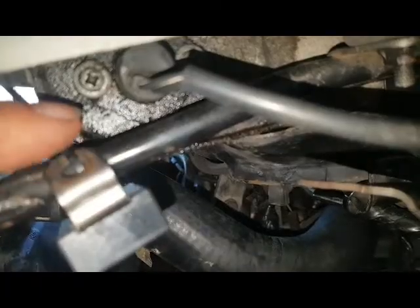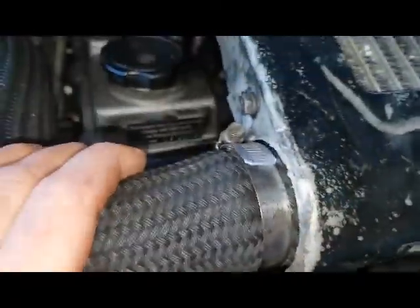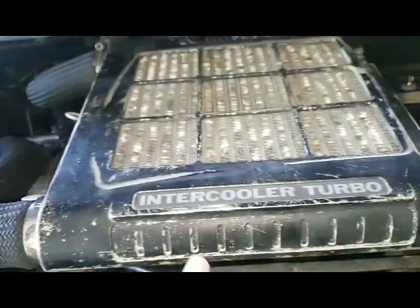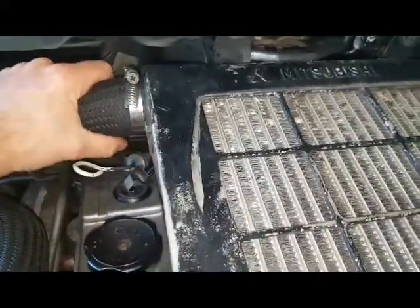There's a lot of oil from that leak which I'll fix, but it's also going to be gumming up the inside of these cores — the intake and outlet down to the engine. This is from the turbo. Air comes in through the air filter into the intake side of the turbo, through the compressor wheel, and it pressurizes the air. When you pressurize the air it gets hot, so that's why we have an intercooler. The hot air comes in here, and just like your radiator which cools the engine coolant, we're going to cool the intake air going into the engine.